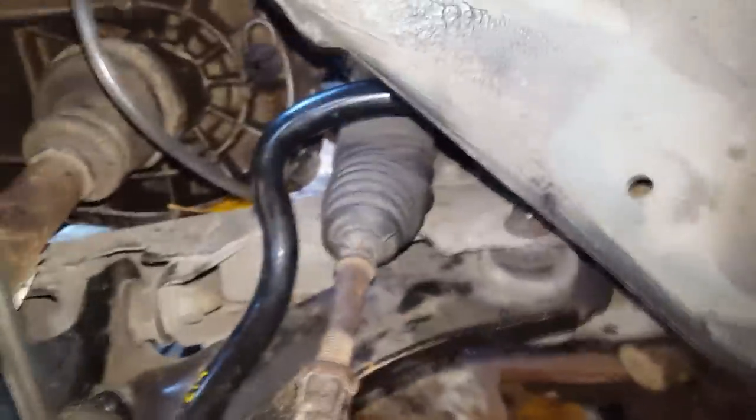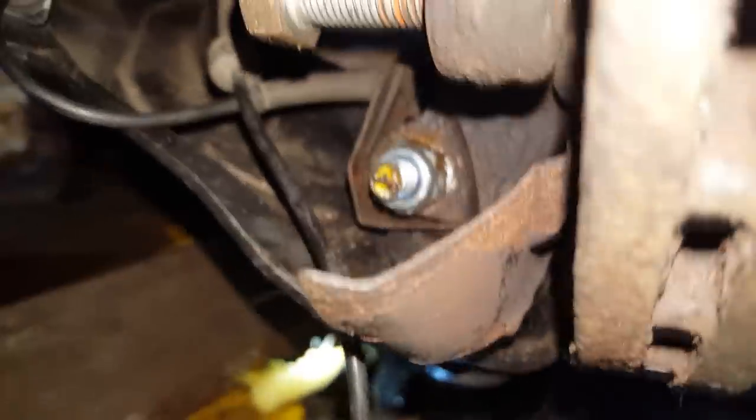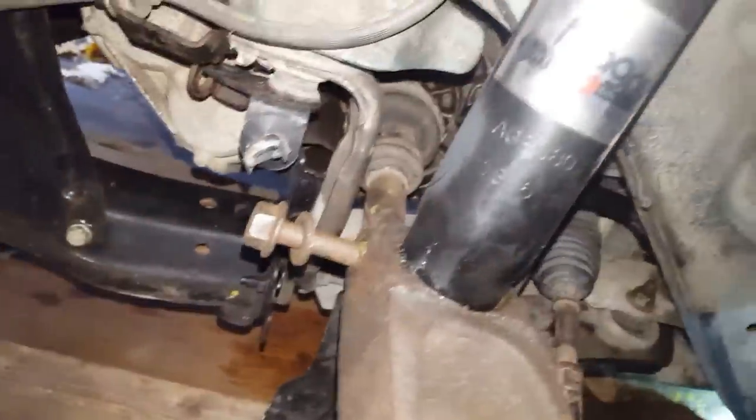Okay, just hand tighten it there and that's about it. Had to fill it up. Inspect that there are no leaks anywhere. This ball joint actually goes through there, because you can see here are threads, so this must be the other end of the threads. Here I had to put it under the stand and I picked this up so I could put this in. I had to lift up the lower arm a little bit until it fit in place. Then it's the easy part, just with torque. It's a 17 mil wrench, but anyway, I just put this one, 18 mil. I will use the old bolt, it's not very wise, but I don't have a spare part, so let it be.